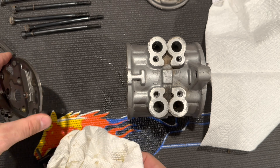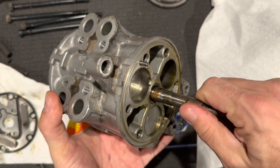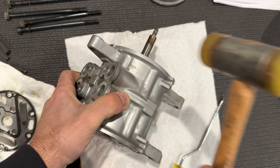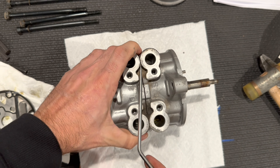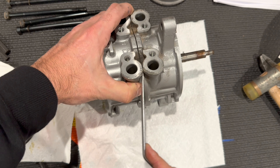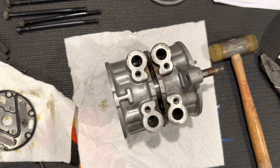From the compressor here, there's not much to it — you have a bearing in there and the three pistons. As you spin it, the three pistons oscillate. There's still one more O-ring in here so you do need to split these halves apart. These can be a little tricky to split. I find that if you start tapping it with a rubber mallet you can get it started, then come in with a screwdriver and spread it out. Use pry points that aren't where the O-ring is going to seal, because you don't want to compromise that surface. Don't be tempted to jam the screwdriver in there — that's how you can damage the sealing surface.